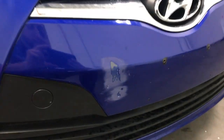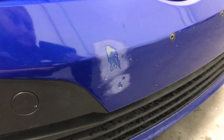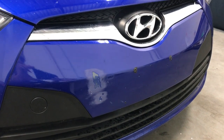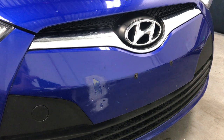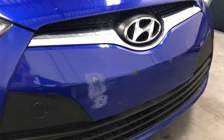I didn't have this on video, but the first thing I did was sand this rough area with 400 grit sandpaper, dry — you don't really need water. So now we're going to cut a piece of vinyl. Then I have to clay bar this area. You want to make sure it's clean, and after that we'll wrap.